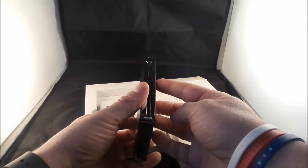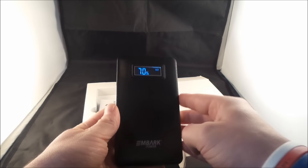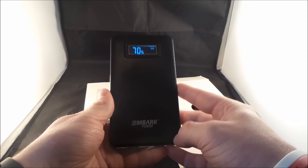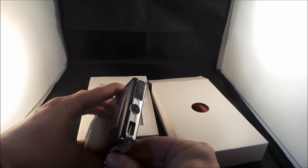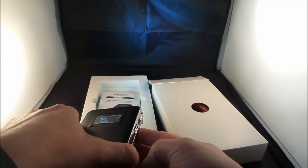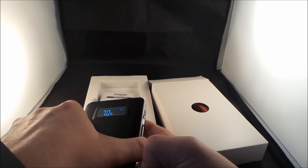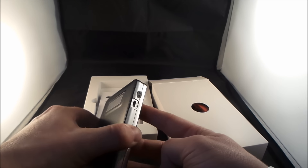So this actually isn't too bad — it's not too heavy. Let's hit the power button. This comes out of the box with 70%, and the user manual actually says you want to be at 70% minimum to even jumpstart a vehicle. The other thing is not only does this serve as the power button, but it also turns on the LED flashlight right up here. Press and hold for three seconds and there's your LED flashlight. If you press the button one more time, it'll actually signal SOS — so if you're in danger, you have the SOS Morse code. And then you also have the strobe light, press it one more time and it turns off.